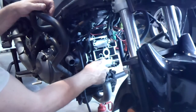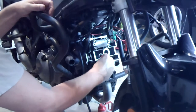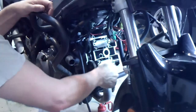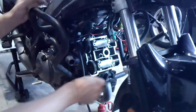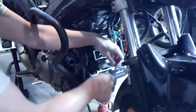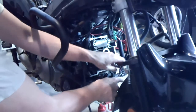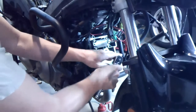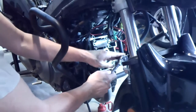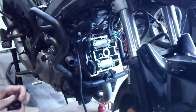So now I've got my bolts snugged up to the point where they're contacting the cap, but I still have a gap here as I press this down on the journals, and I'm just going to go in opposing sides and slowly draw this down evenly. I can actually do it with just finger tension right now, but it's getting tight now where I need my ratchet. A little bit each way, and bring it down slow and even. Alternating. Don't be in a hurry and bring this cap down at an angle. Okay. So now I've got them all snugged down. They're just snug, not torqued.